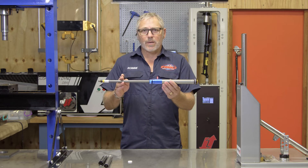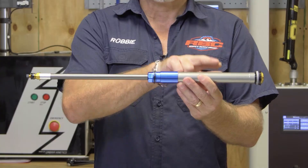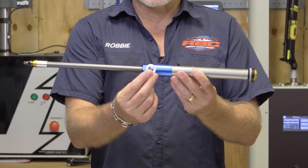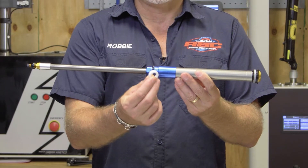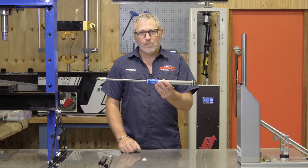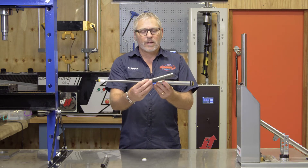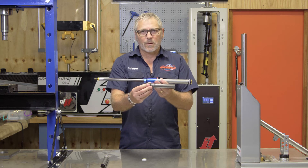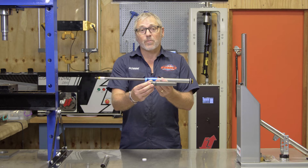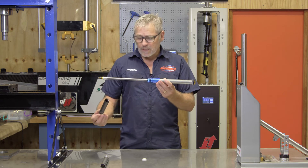You've got a ramp-up chamber here, you've got your negative chamber here, and you've got your positive chamber. Incidentally, the negative chamber comes with a separate air token, so you can actually tune it. The positive chamber — this one is at 170mm of travel, but you can actually change the travel by changing your positive chamber from 90mm all the way through to 170mm in 1cm increments.